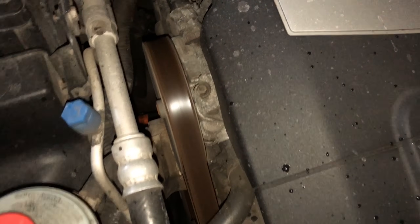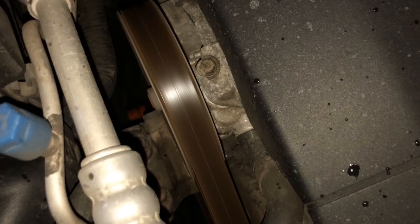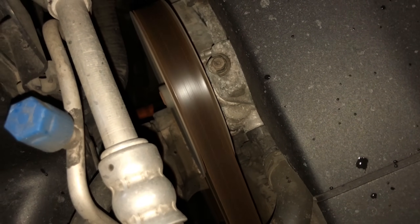Now in this episode I'll be addressing a noisy drive belt. A typical issue for a lot of cars is that after a while you start hearing this — kind of a mixture of squeaking and grinding. In a lot of cases you can resolve it by simply replacing the drive or serpentine belt, which is a very easy thing to do. But in my case it didn't help, so I had to replace the drive belt tensioner.